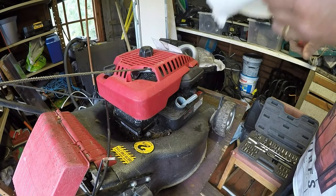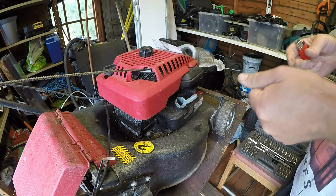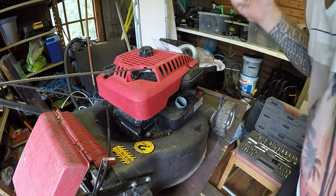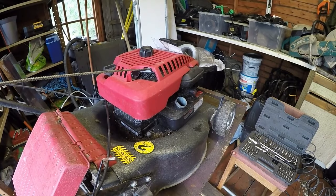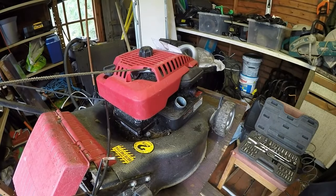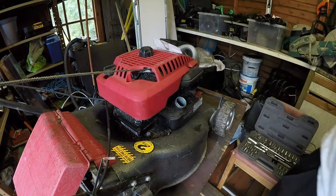Yeah, see, that's not lighting like petrol does. It's more like diesel. I don't know. Either way, it's not right. It could be 2-stroke petrol. It lit quite quick. Diesel doesn't tend to light like that, but probably 2-stroke petrol in there. So we need to have that off straight away, because that can't stay in there, and that's possibly the reason why it's come to me. As I say, this one is sold, so I want to get it up and out.